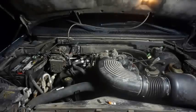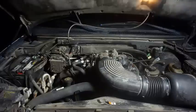Alright, good evening YouTube. This is going to be my first video for diagnosing a 2001 Ford Expedition 4.6 liter V8 Triton. Now the issue is this vehicle will crank, not start. After a lot of research online, a lot of forums and a lot of dead ends, and replacing a fuel pump, fuel filter, and a few other things, cleaning out the mass airflow sensor, just a general diagnosis, found out that it was actually the key.